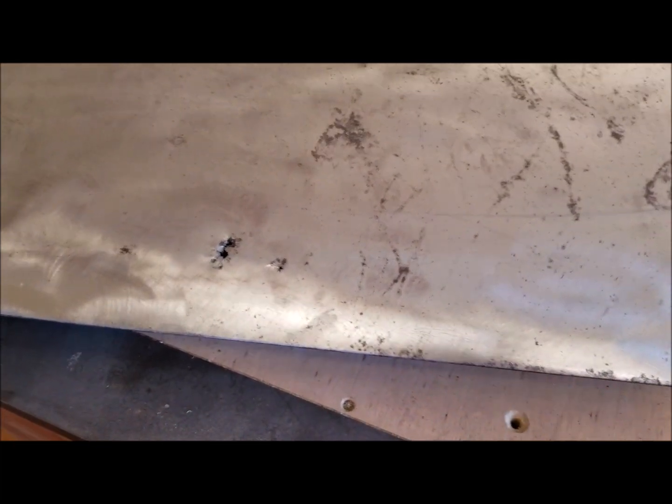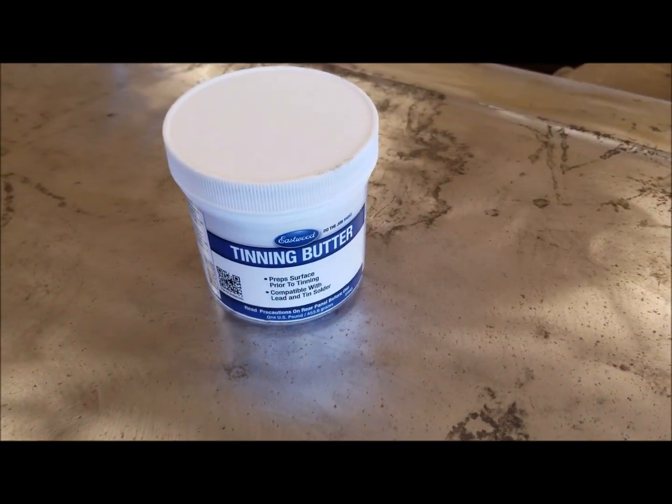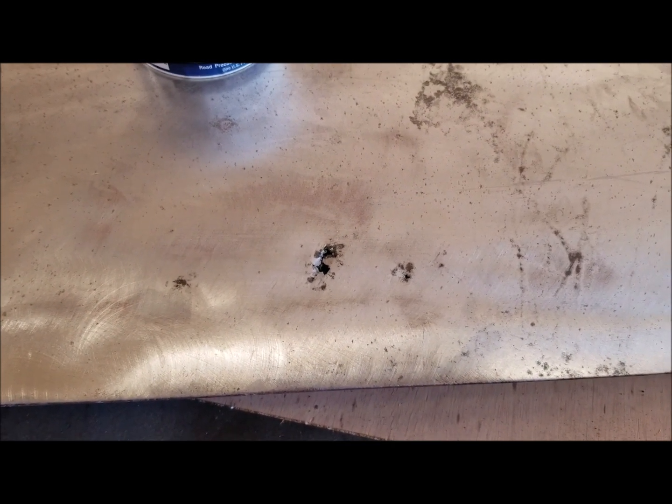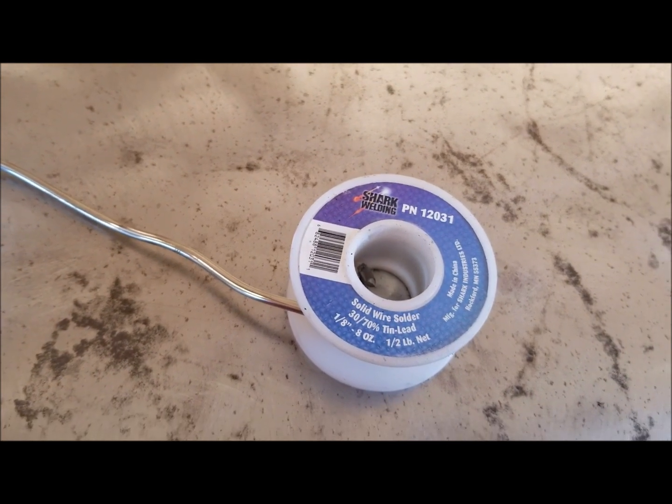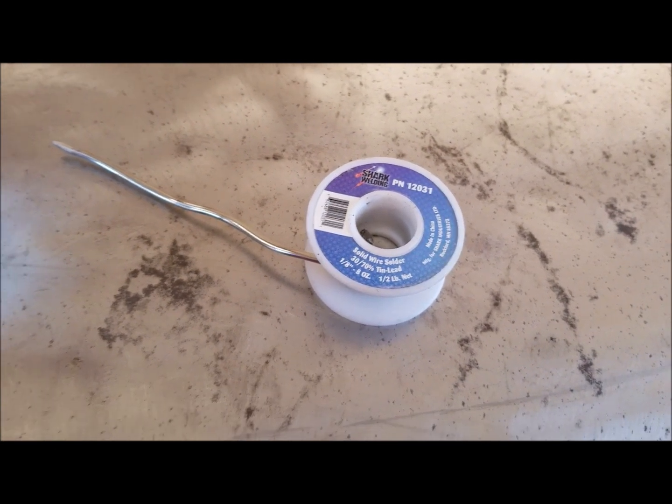It's an interesting spot. I suspect, as they were sitting in the barn for 40 years, the door filled up with water, and that happened to be the water level that it kept hitting as it would fill up and then drain. So what I'm going to try — I've considered brazing them, I've considered lots of different things. This is not a structurally super important spot, so what I'm going to try is solder it. I bought some Eastwood tinning butter, and it's my understanding that you spread that on the surface and heat it with gas until it turns brown, then wipe it off. Then I should be able to solder it. I've got some 70-30 solder to use, and we're going to try filling those holes the old-fashioned way.